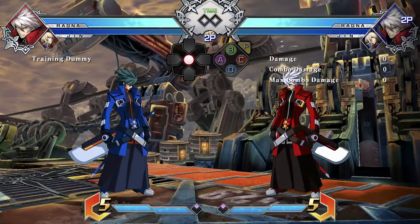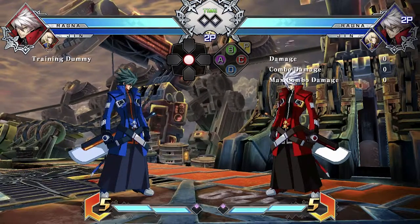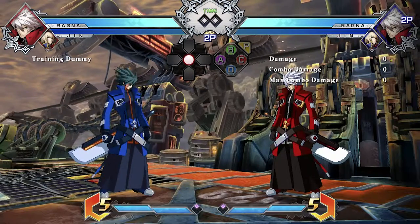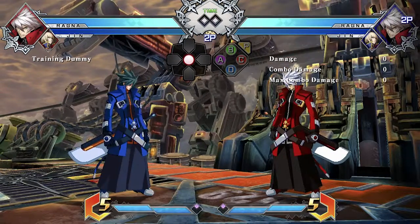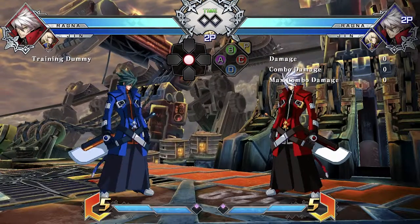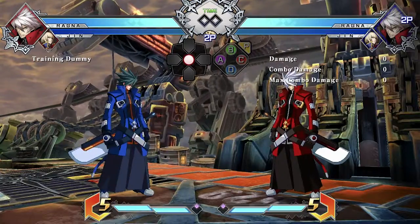Typically, I do the testing of the controller before I screw everything back in, and I even keep the battery out. I typically just plug it into the USB-C cable, plug in my Switch, and turn it on. I highly recommend when you do a shell replacement, before you close it up, if you have a fighting game on your Switch, load that up, because typically fighting games do test out all your buttons, and it makes it easier to tell if it's working the right way or not.